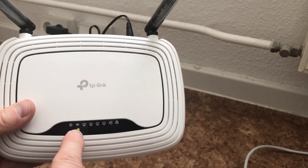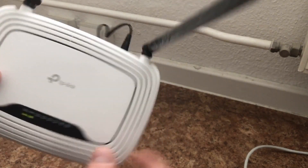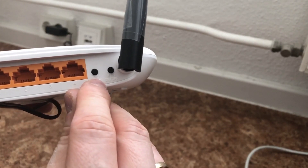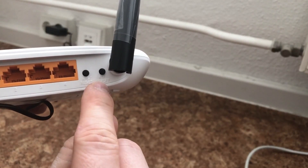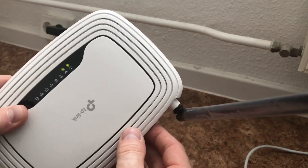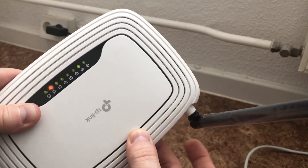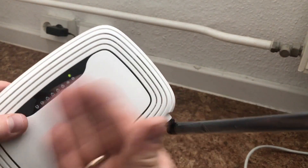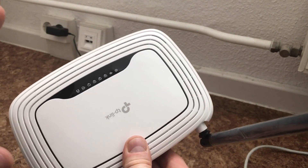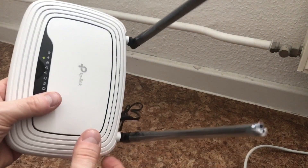The second lamp, the wireless lamp, is now on. Now the router is ready to be put to factory settings. On the back of the router we have two small buttons: the Reset button and the Wireless button. We press the Reset button and hold it for a few seconds until the lamps go off and the router restarts. Remember, putting the router to factory settings is only needed when the router is not new — when you got it from your neighbor or brought it from home and it was already in use.